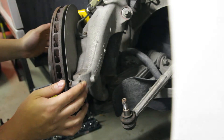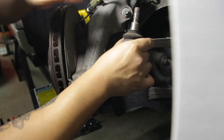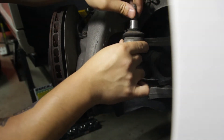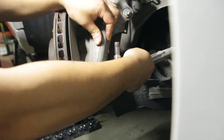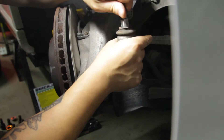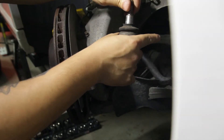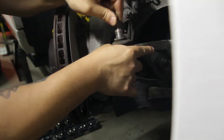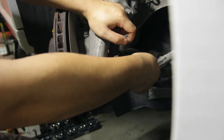So I can turn this out of the way to fit my big inner tie rod removal tool. Like I said, the outer tie rod isn't terrible - I probably wouldn't be replacing it if the inner wasn't so bad. But there's a lot of play on the inside. A brand new ball joint should be kind of hard to move - I can move this with just a finger - so it really should be pretty difficult. But yeah, there is some play.